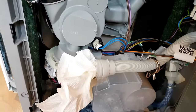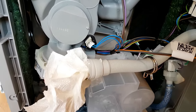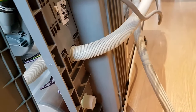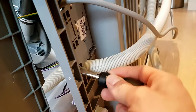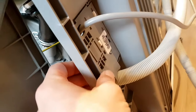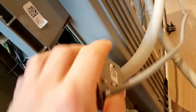I've just put a little bit of kitchen towel in the end of the hose to reduce any further spillage. Now I need to go to the rear of the machine where you can see where the pipe actually exits the machine. This particular model requires just a flat-head screwdriver to prise this panel out using two clips. I can push that out and get that one out of the way. I don't need to disconnect anything else here because I've got access to slide that hose out.